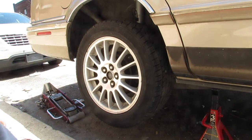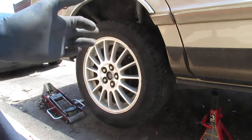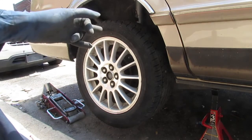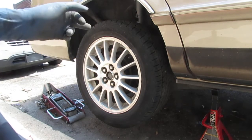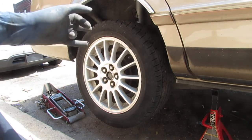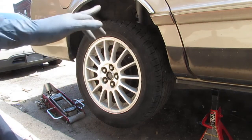Alright, that's the end of it. It's pretty straightforward as long as you don't have rust buildup. If you're lucky like this owner, you definitely want to grease those bolts. At some point also apply a spray lubricant on that spring perch like I talked about. Otherwise that perch spring is going to break and you'll end up having to replace the entire bottom crossmember bar.